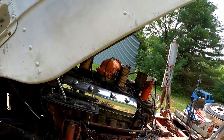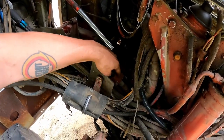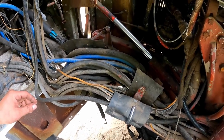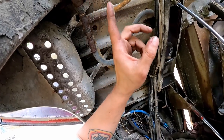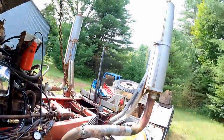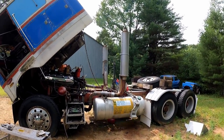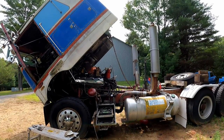But yeah, so when I did the oil line into the cab, this junction block down here at the bottom, there's actually, where is it? This line here comes into this auxiliary tank, and I had left it disconnected because I needed to disconnect it to get to one of the other lines. So it actually built enough air to turn the light off. I think it would release the brakes, but I gotta be able to put the cab down to do that. Right now it's more important that I do what I'm trying to do.